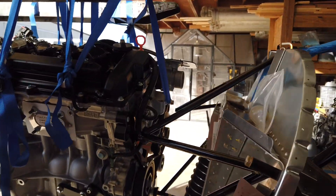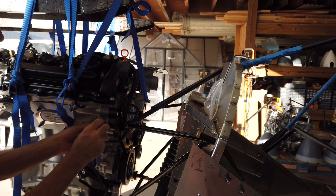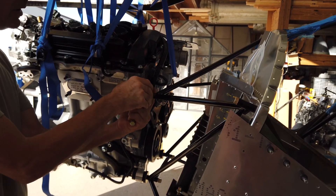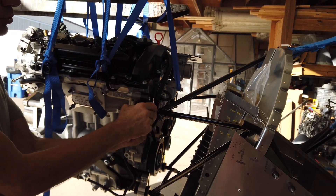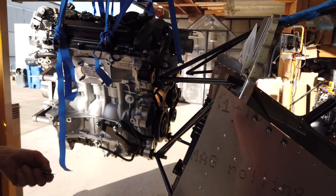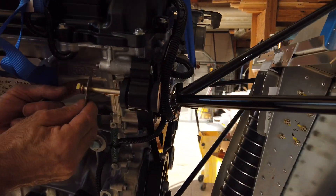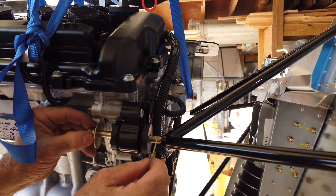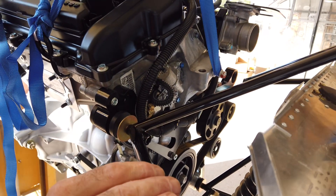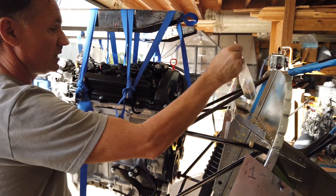One thing we did: we didn't get in a hurry to tilt the engine back. We did the bottom first — haven't tightened them yet — then we left it away a little bit so we can get the rubber dampers in easily without having to pry. We also made sure there's no way the airplane can fall on its tail, because that's a real bad day. We have our AN6 washer, a modified fender washer with the smaller curve towards the engine. We'll check on that as we tighten it up, and then there's a full-size washer through the engine mount. We're going to install the other side and then lift the tail and put the nuts on.